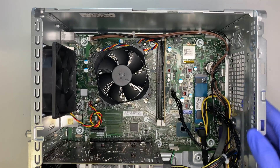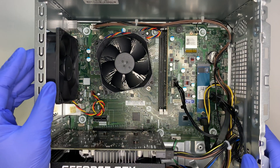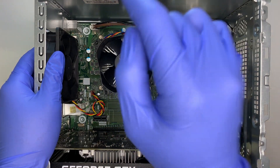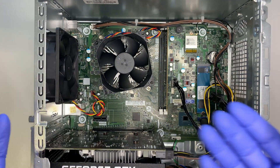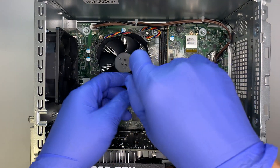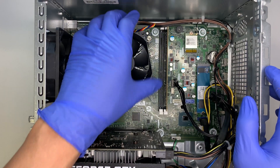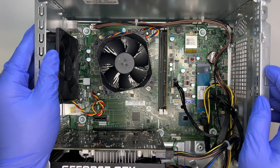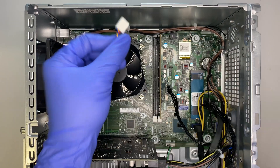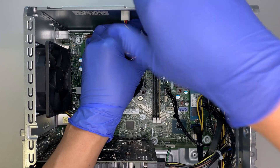Let's focus back into the main parts. This is your exhaust fan, which blows hot air to the back of the computer. This is your CPU — the CPU has a regular fan that blows hot air underneath the heat sink. If you want to remove or replace the CPU fan, you need a Torx screwdriver. Unscrew the four screws, disconnect the CPU cable, and the entire CPU cooler will come right out. I'm going to disconnect the connector by lifting it up and unscrew the heat sink.